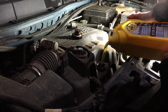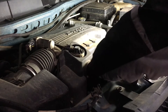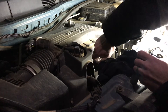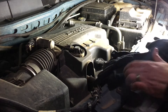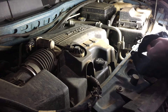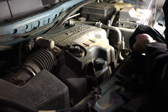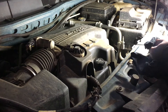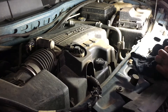I'm going to shoot for about four and a half quarts. Not too bad on the spillage — that's clean. Let's drop that in the hole and seal the rest up. Now let's check the oil level. I'll clean part of my rag and wipe off the dipstick — and it's full. Let's go ahead and start it and get it off these ramps.